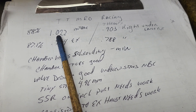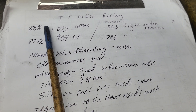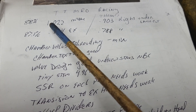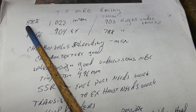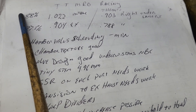Intake valve size: 1.022 inches. It sounds big, it looks tiny. It's got an 88% throat — not bad, usable. The only thing I can say about that though is they go from the throat, and the rest of the port is basically the same size as the throat all the way down. I'm not thrilled about that, but I really don't want to make that throat any bigger.